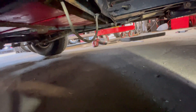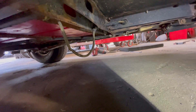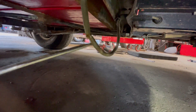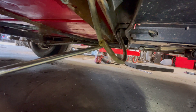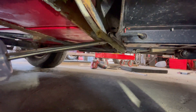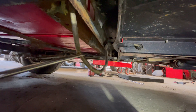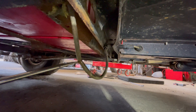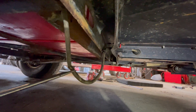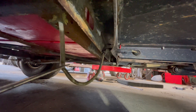Under the cart, I found the wire hanging down — and look at this. There's a spot right here where the wire has been damaged. Someone hit something and pinched it, and there's also corrosion built up in that spot. The wire got nicked and then corrosion built up until it completely cut through the wire and stopped the current. We're going to cut this apart, pull the sheathing back, splice it back together, and we should be up and running. I'll do the repair and come back to test it.